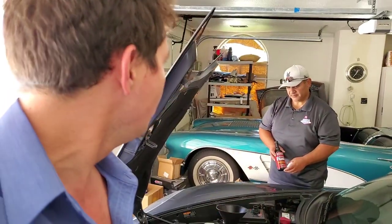It's going to basically break up all those years of burnt-on material. There are areas in the engine that get very hot and they don't get a lot of oil flow to cool it, so in those little areas it kind of burns and thickens. We're going to be wiping all that out — it's going to go into the oil filter and the oil pan, and this thing is going to become a new engine.